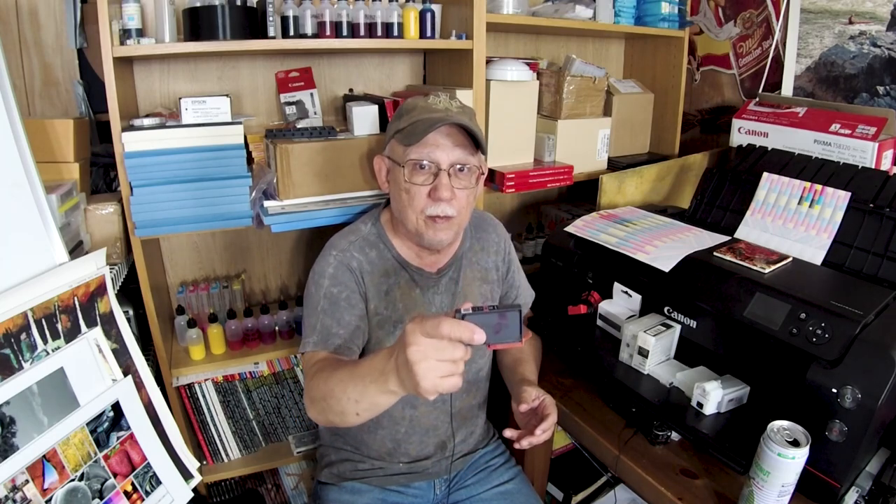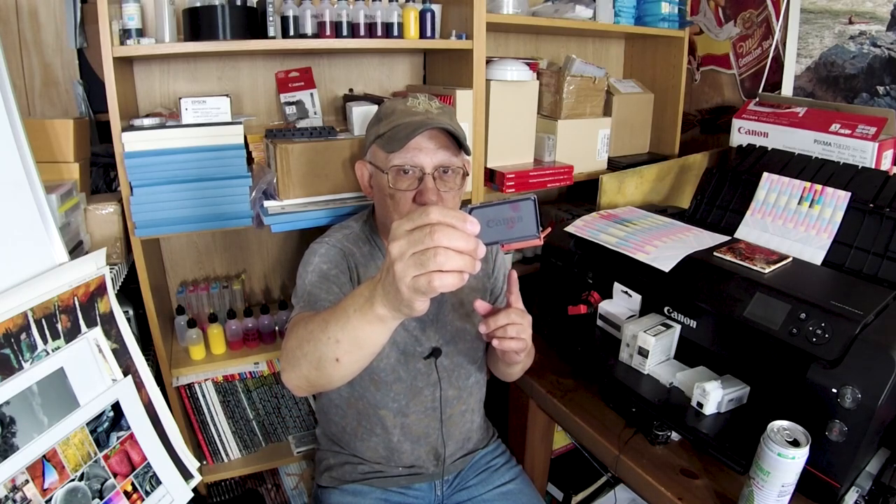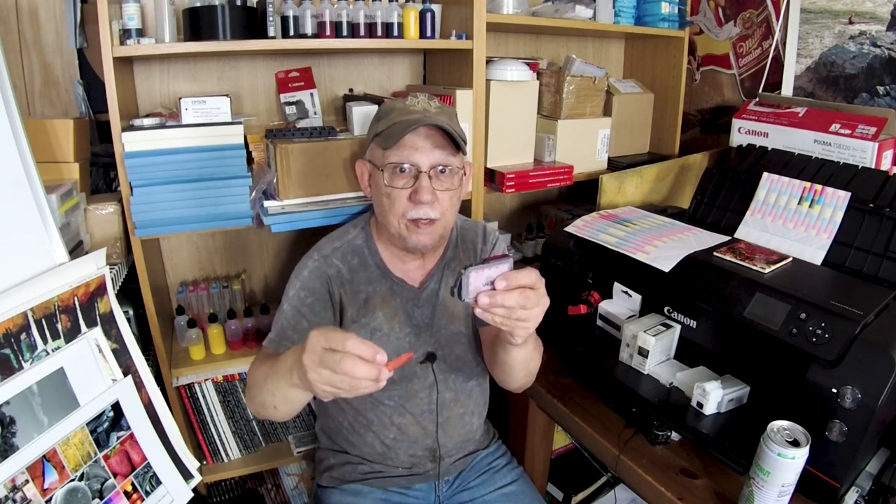Now the Pro 300 — there's no difference. You'll have to disable ink monitoring as well, one cartridge at a time as each reads empty. With these you can let it go empty because these have an internal bladder that holds the ink. These have a sponge and the sponge has to be maintained — it's a little bit more finicky and requires the correct hydraulics. This has a built-in diaphragm that pressurizes against the bag, and that will deliver the proper ink flow to the printer. They're identical to these folks. You basically remove the cap and dribble ink in until it reaches 32 grams of total weight. That is it.